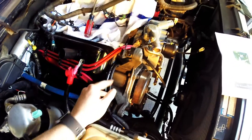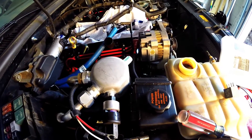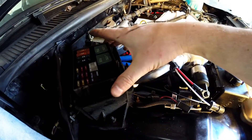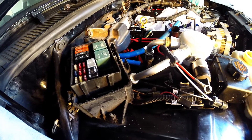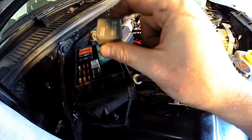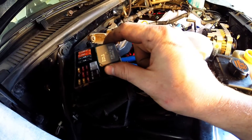Probably the trickiest part. I'm going to put the alternator back on, go backwards, then mess with the fuse block end. Alternator is reinstalled, everything's bolted back up — power wire, ground wire, all the brackets. We move over to this guy; it says to remove it. Basically you're supposed to take out this gray — at least mine's gray — bone stock '96 air pump relay, so you take that out. I would take that out first before you pull this out of here, it just makes it a little bit easier.